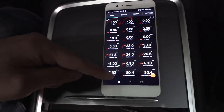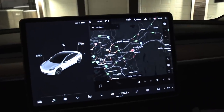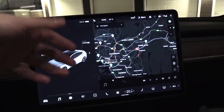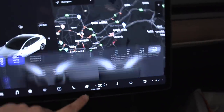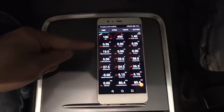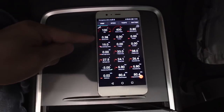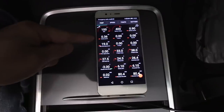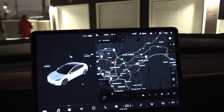Since we are stationary, it's actually pretty safe to run the car all the way until it shuts down because I can just plug it in again. The setting is that I have camp mode on, 20 degrees Celsius, auto — and that's it. When the battery is nice and warm, we're spending very, very little energy. Some of this is to power the screen, the pumps, everything. The heat pump is sucking almost no power right now. It's just insane how efficient the new Model 3 is.